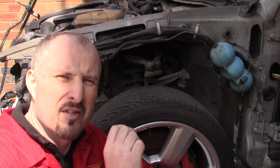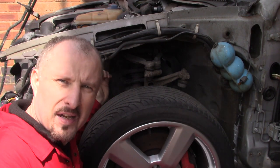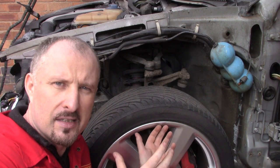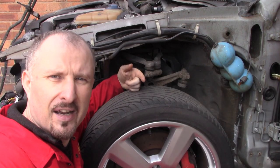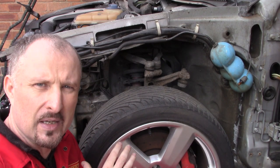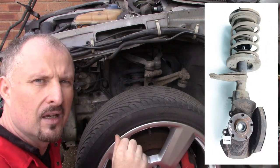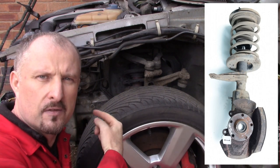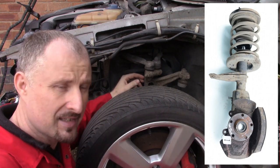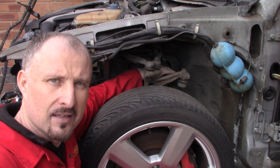When I used the steering rack from the original Audi A6 donor car, the arms on the strut faced forward — the same as on the BMW E46 front hub carriers. So the steering rack on the Audi A6 C4 moved in the correct direction and the steering worked well. I tried to find video footage showing the early suspension setup of an Audi A6 but couldn't find any. Here's just a picture to show what I mean. If you see that the steering arm on the image faces forward — now if you take a look at this one, the steering arm faces backwards, which means this steering rack works in the opposite direction, which also means I can't use it on my supercar.